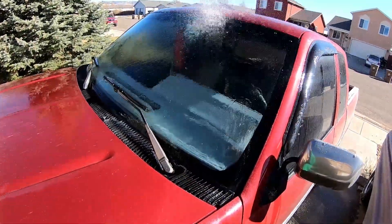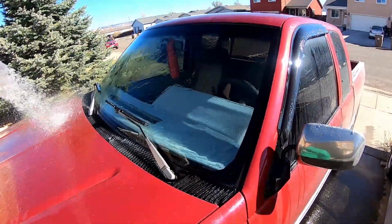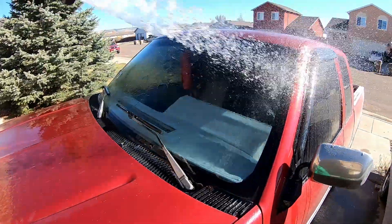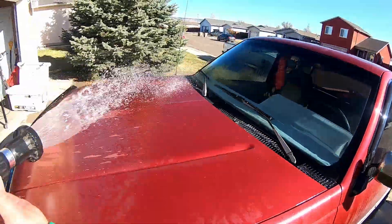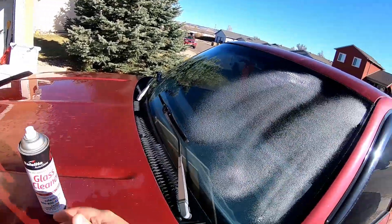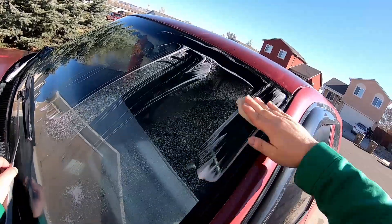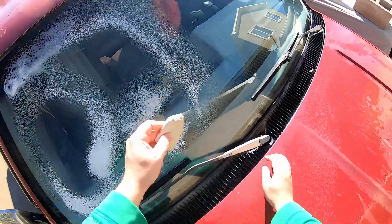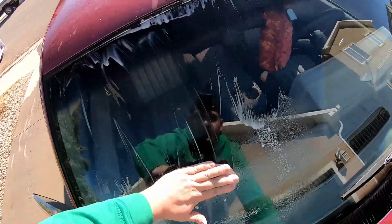I'll show you cleaning the glass — we're going to spray some water on it and you'll be able to see the surface is completely flat with no beading at all, more of a slow sheeter. This glass is in rough condition with lots of pits and some cracks, so I thought this would be the perfect glass to test on. Now that the glass is dried off, I'm using some glass cleaner as a lubricant for clay barring — getting all the imperfections and anything embedded in the glass out so we have that smooth surface both products are asking for.